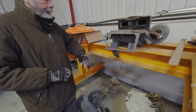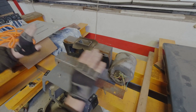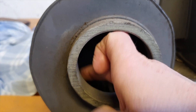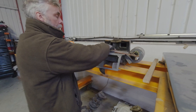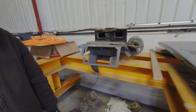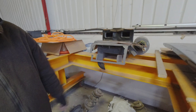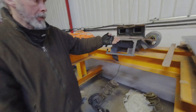You've taken out the heater system — the heater matrix. So this is the bit behind the dashboard; that vent goes up to the windscreen demisters. The motor blows air in from the engine bay through that hole there, and inside that bit is a heater matrix — hot water from the old petrol V8 cooling system went into it. There's a little flap so you can blend between hot and cold air, and these vents come out into the dashboard — some blow into your face, some blow air down onto your feet.